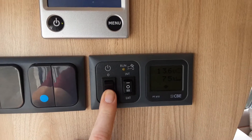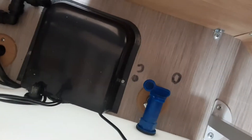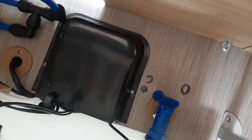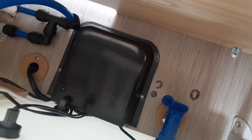Water pump power — put this switch on here if you want to fill the internal tank, which you do by going underneath the bed at the back of the van. You'd have your Aquaroll connected at this point as you would with a normal van without an onboard tank. To run the water system you'll need to make sure the drain-down valve underneath is closed. We've put a C and an O on the floor so that when the ball is pointing towards the C, the valve is closed so you can fill the system; flip it to O to drain the tank. Make sure that valve is shut if you're going to run on the internal tank.